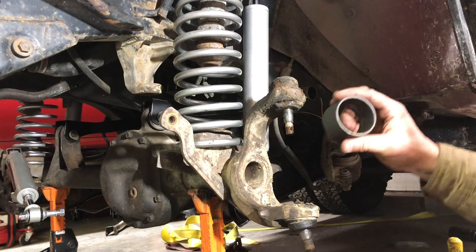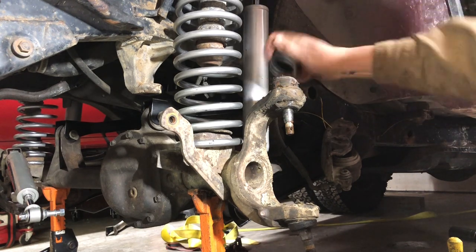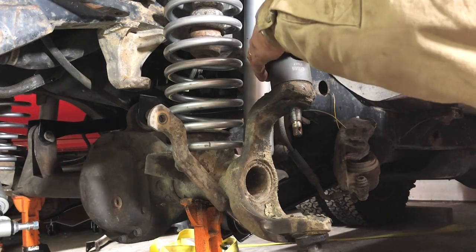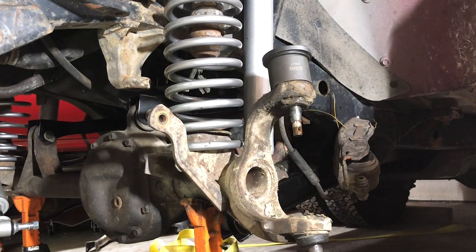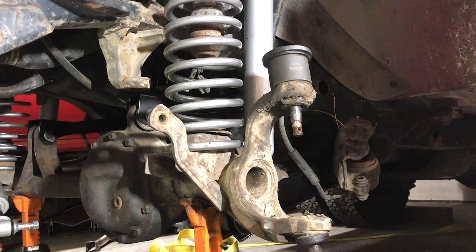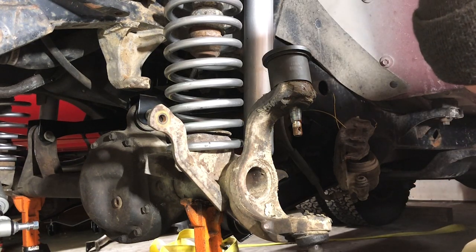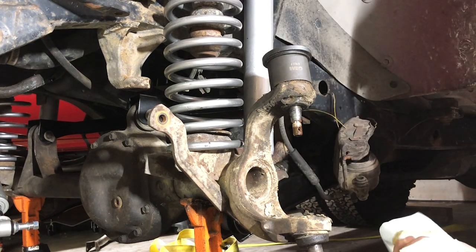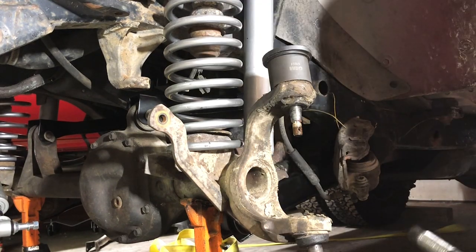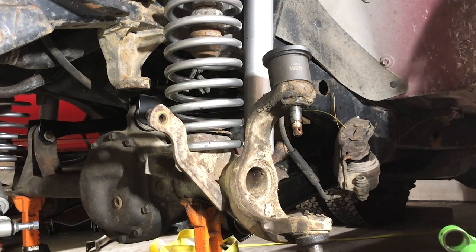Okay, so on this guy, what we're gonna do is take a cup that fits over the top here. It is too small. I'm gonna go up a size to right here. Something like that. Good practice on these ball joint kits is to always make sure they're lubed. We'll just hit that with a little penetrating fluid just so it's not running dry. Especially on these part store loaners, you know, they sometimes have been a little bit abused.